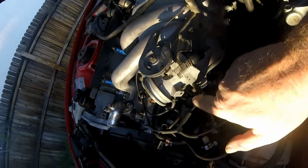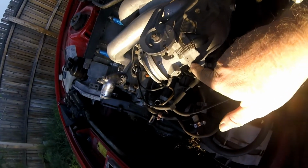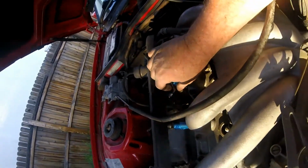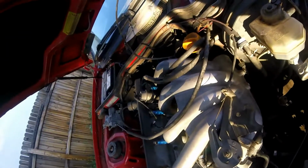One side goes to the throttle body, which is right there, and the other one goes to the splitter, which goes to your fuel rails. I might need a different elbow for that. If it all works, I'll paint that black and nobody will know the difference. Okay. This one goes back to the other side of the 2-position. Already got the 2 fuel rails. Done and done. There is no extra small vacuum.